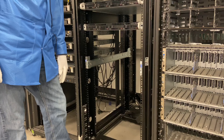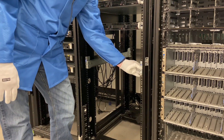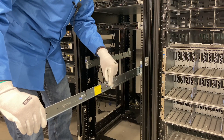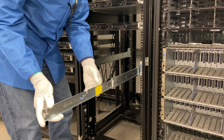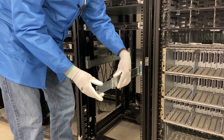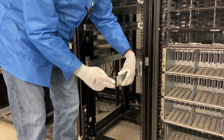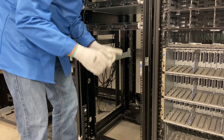One thing I wanted to point out before we actually put the server into the rack are the inner rails. When you slide these out, you'll notice a couple of things. Most importantly, if I were to try to push this back in, the rails are completely locked into place. So you need to make sure you push this down and now your inner rail will slide in. The same thing — if I try to push this back, it's still locked into place because this inner rail isn't all the way in. So we need to make sure this goes all the way in, and then it will fully slide all the way back.